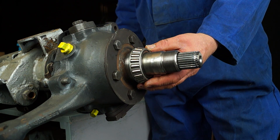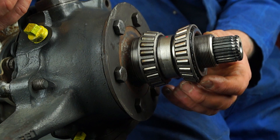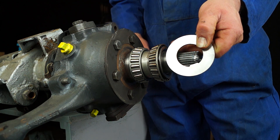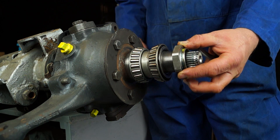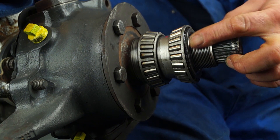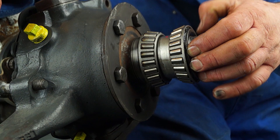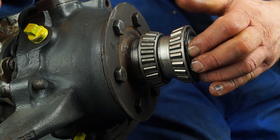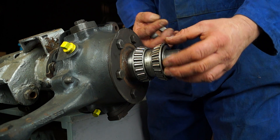First of all I have a TD5 axle which is preloaded, with a bearing and then a collar in between the bearings — that's the rear and the front bearings. You have a washer here that goes before the hub nut, which also retains grease to a certain extent. You also have one single lock nut which is staked. This is to stop the bearings from going too far and nipping up too tight. So when you put a torque on it of 210 newton metres, it will actually hold the bearings just right at the correct adjustment — this is sort of idiot proof. The collar itself that goes between the bearings is not collapsible, which means this bearing preload is not adjustable.